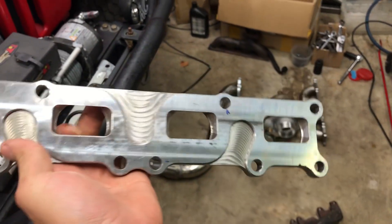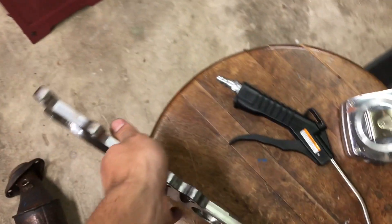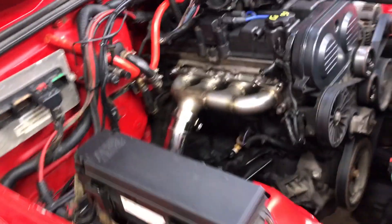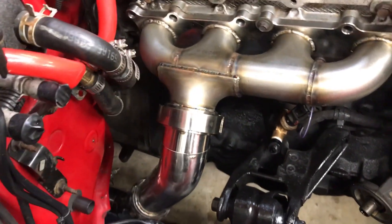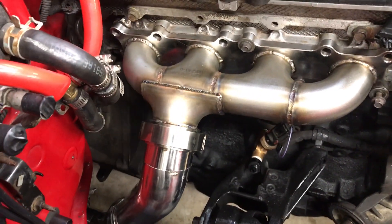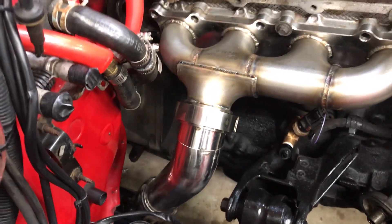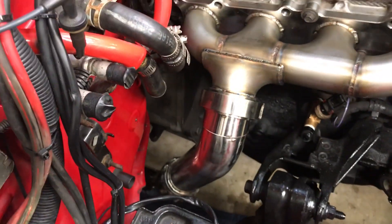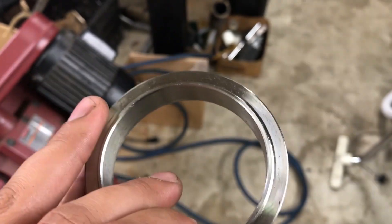The flanges also have some cutouts in the back to reduce the possibility of warping of the manifold if you get it really hot. From there I went to a 2.5 inch V-band. V-bands ended up being my favorite type of flange because they're so versatile and there are no gaskets involved — just the clamp itself that clamps both pipes together. Basically you get two halves that have a little V-shape, so when you tighten the clamp down it pulls them together and makes a perfect seal.